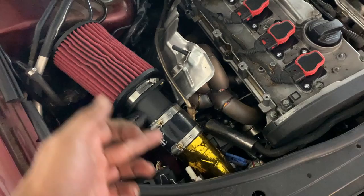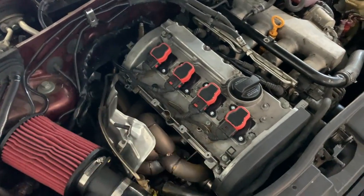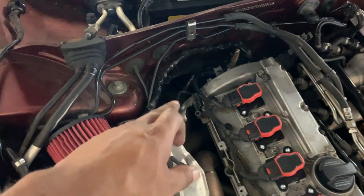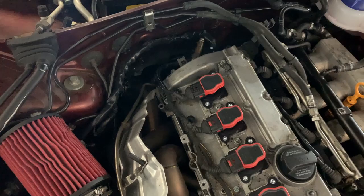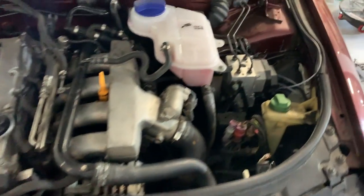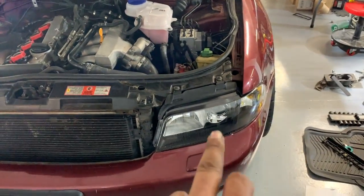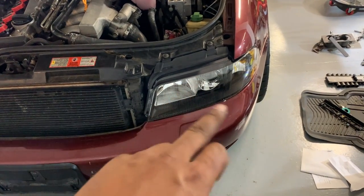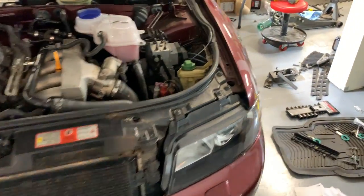It's got a good turbo. I got the Evolution Raceworks hard aluminum intake pipe, the AEM filter that I actually stole from the Mustang, R8 coil packs, a downpipe, and then the factory exhaust out the back. It's great because I've got full straight pipe essentially, but it has the factory muffler and resonator so it's not obnoxious, but I still get the power gains. Stock intercooler, stock fueling — I'm just going to have someone tune it as it sits right now. It'll be enough power for what I'm looking for. I also put new projectors in there. This was a factory HID car so I kept it that way — put in some Phillips or Osram HID bulbs because the previous owner had cheap Chinese ones that looked like garbage and weren't bright. I also had the ABS system rebuilt because there was a fault.